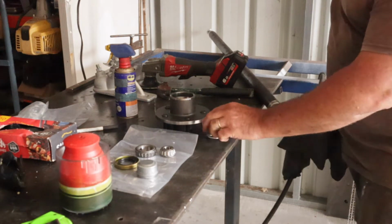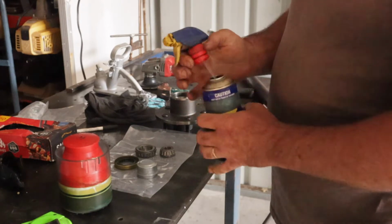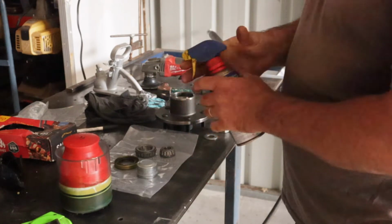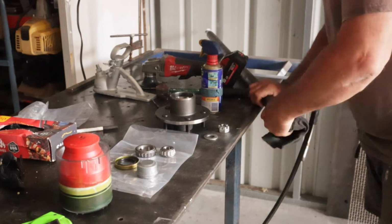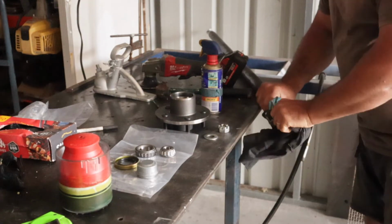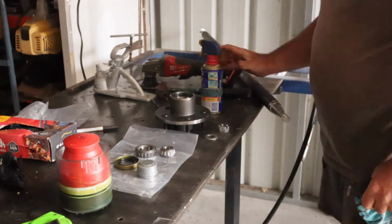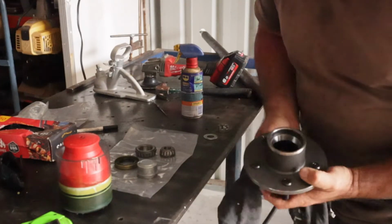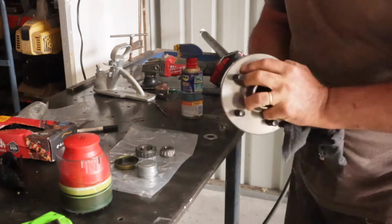these are all just pre-bought off-the-shelf parts. I like to use a bit of, this is actually wax and grease remover. It's inside one of those aerosol-free cans, and I just pop the top, refill it with wax and grease remover, and just keep it on hand. Fantastic. Just like to give everything a nice clean. Make sure there's no grit, and you never know, the slightest little thing can upset a bearing, and then before you know it, you're in a bit of a world of pain.